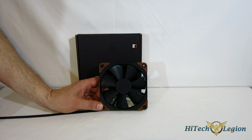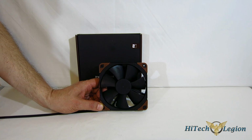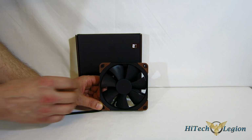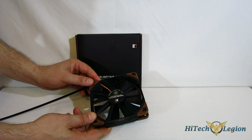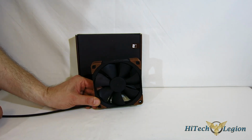What that means is it cannot take in any dust, period, into the bearing whatsoever, harmful or not. And the 7 rating indicates that it can actually be held underwater up to a meter for 30 minutes and not be affected. So obviously, water coolers are going to be licking their chops over that. You can have a leak, spray, whatever within the case, not going to affect the fans.